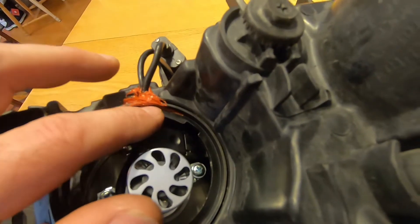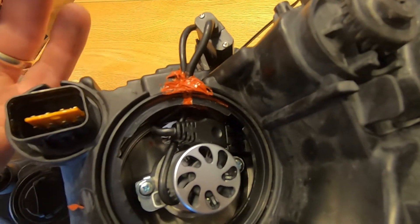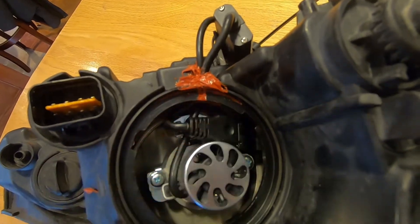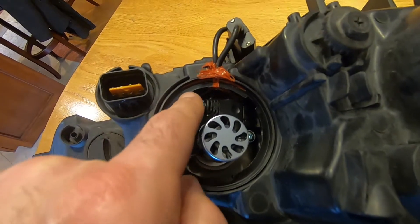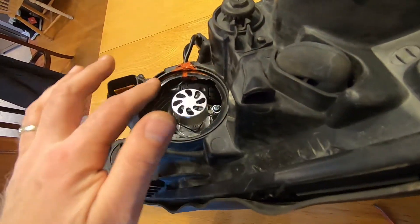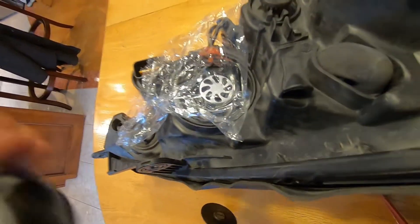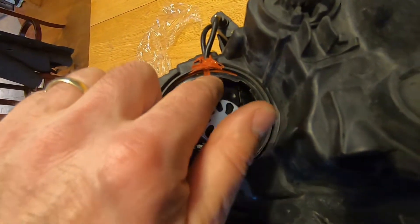Your lights may be different, so take a look before cutting. My concern after making the cut and running the wires was that it would no longer be watertight, so I used RTV silicone in there and let it harden overnight. I also wanted to make sure the o-ring in this cap had contact with a sealed surface. I smeared some RTV silicone in the gap, took a piece of cellophane, placed it over the liquid silicone, put the cap over it, twisted and tightened the cap overnight. When I removed it, the cap wasn't stuck to the silicone, the cellophane peeled off, and now I have a good surface for that o-ring to contact.